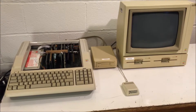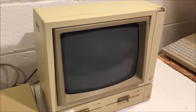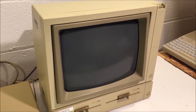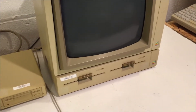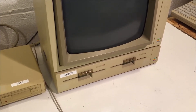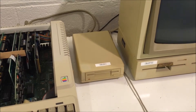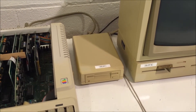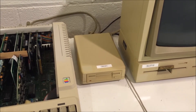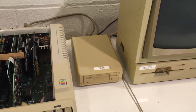So now let's look at the hardware configuration of my Apple IIe Platinum, starting with the stuff on the outside. First we've got the pretty standard Apple II monochrome monitor — can't really have an Apple II without that. I do have color TVs I connect to it for color, but 80-column applications really need a monochrome monitor to work well. You've got the standard DuoDisk five and a quarter inch drive. And this guy here is a little oddity — he is a three and a half inch drive, some generic third-party thing. It's not an Apple branded device at all but it works really well, very handy for moving files between the Apple II and my Apple IIc Plus, my IIGS, or one of the Macintosh computers. This guy is an 800k drive, so that's pretty cool.